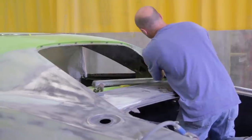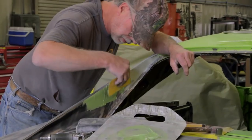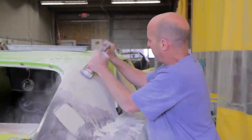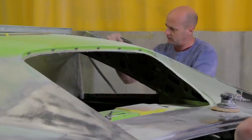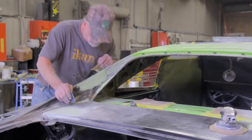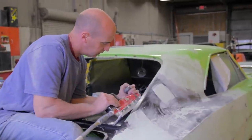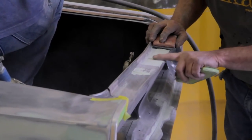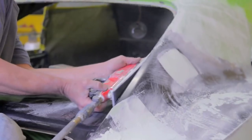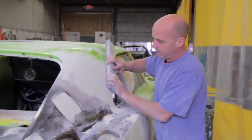The collision job on the Charger's moving along. Once the sheet metal's on and welded up in the factory places, then it's time to do the cosmetic work — plastic filler over all the panels — make sure that they're square, straight, and you've got good gaps. Then you're ready to primer them. That'll be what comes up next after the primer gets blocked, then re-primed, then re-blocked, and ready for the sublime green paint. An original manufactured car was done in a single stage enamel — it was orange peely, had runs. Most of my clients have preferred to have a better finish. I've got good body men, good painters, good assembly guys. I can turn a certain department loose and know that when it comes out, it's square, straight, and flat.